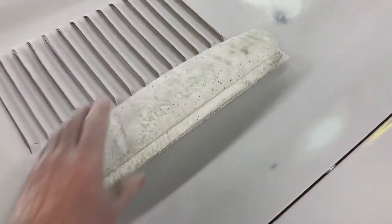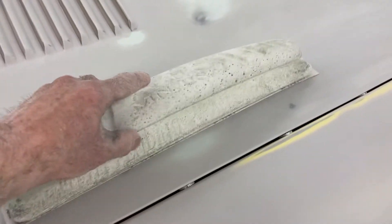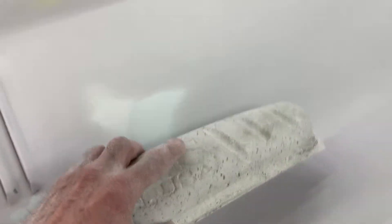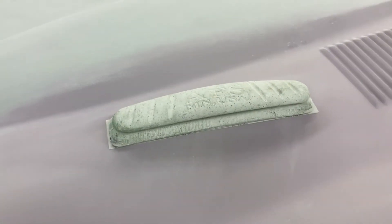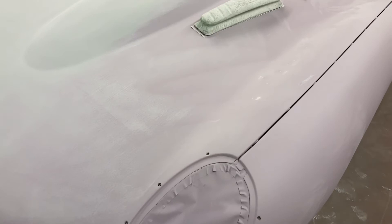I wanted to show you these sanding blocks. You got to be careful when you are sanding because of the curve on this one here. If you can see here, it's lifted up a bit in the center. So what happens when you're block sanding is you end up digging in on each end of the block. So you got to be careful when you start sanding, especially where you have the pink areas here. Just take a look at where it's sanding and you can see that it digs in in spots. So you just have to be careful when you're pressing on it — put your hands over the whole block so it has pressure evenly over the whole thing. And that'll make it easier for block sanding and give you a lot nicer finish when you're done — you won't have little grooves in there. So just a little reminder if you're block sanding.